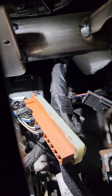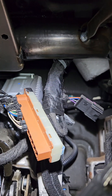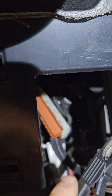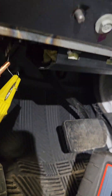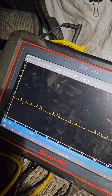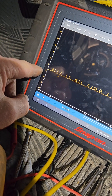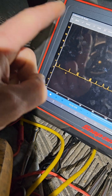You also have a connector because here you have star connectors hiding in the dash. The brown one is for the interior CAN (IHS) and the green one is for the powertrain CAN. All the communication wires get plugged in there — it's a bit hard to access. I had to take out the light switch to get in there with a long screwdriver to unplug the connectors. What was happening is when I put the key to run, the signal would jump almost to 9–10 volts on the communication line, which is no good — it should be around 2.4V on the low side and 2.6V on the high side.